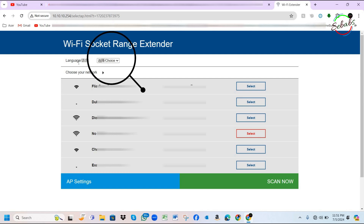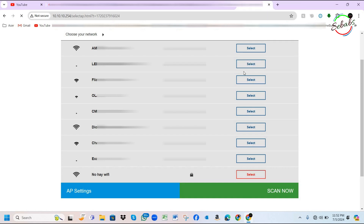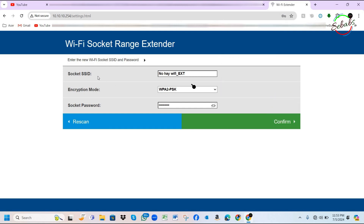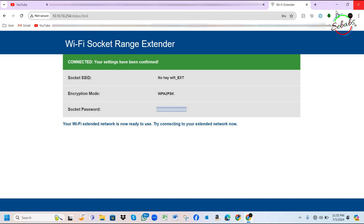Then choose language — in this case we have only two options: Chinese or English. Now select the Wi-Fi you want to connect to and click Next. You'll be taken to another page where you'll be prompted to enter your Wi-Fi password. If your Wi-Fi network is password protected, enter the password; if it's not protected, it's not necessary. Then click Next. The next page will show you the necessary info — SSID, for example — but with an EXT extension so you can easily distinguish it. Feel free to change it whenever you want. Check to see all the info is okay and click Confirm. Wait a few seconds for the connection to update and you can go test it out in the area with the previously poor Wi-Fi signal.